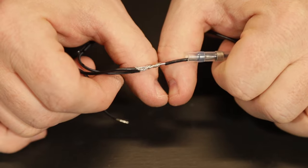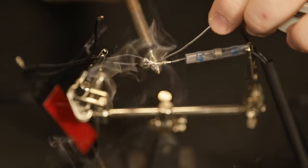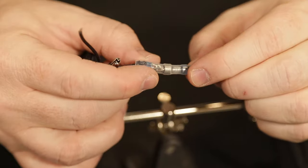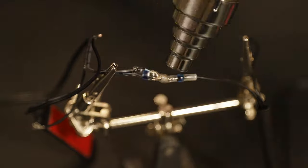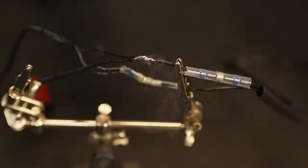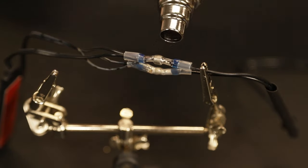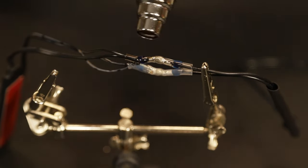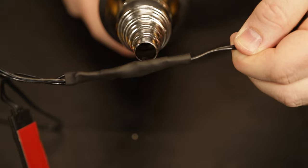Alright, that's not the neatest thing I've ever done but it should hold really well. In each of the solder connections you'll see that I'm going to use quite a lot of heat shrink. I'm going to put on this heat shrink that's got the solder in it as well as a little waterproofing glue at each end — that's the little blue section you see there. When I first started using these I found that they were just a little bit too thin-walled for my comfort level, so after I put this first layer on I'd go over it with a second layer of the traditional black heat shrink. You certainly don't need to do this — I'm probably a little nuts for doing so — but it gives me peace of mind that these are never going to fail.